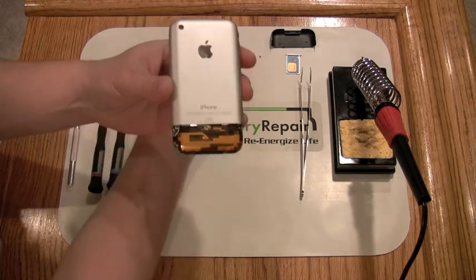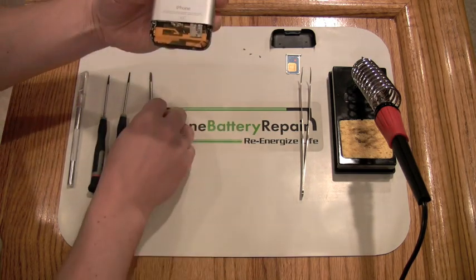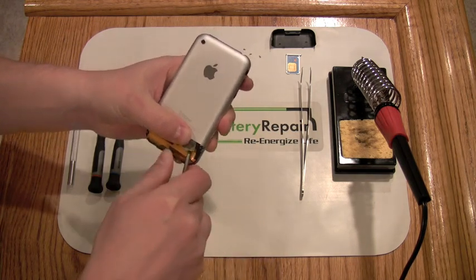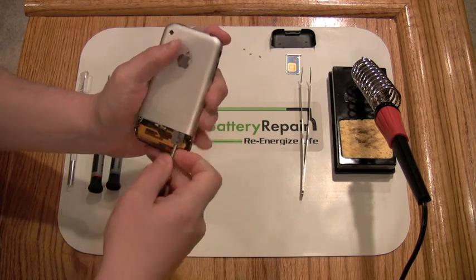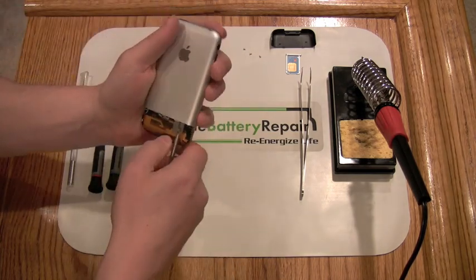Okay, you'll notice that we're using a flat piece of metal in this next step to reduce the pressure point on the back cover. This reduces some of the metal bending and flexing as you apply pressure with the flathead screwdriver. Use the thumb down technique and work the cover. Once you get a crease on the side, you know you're making progress.